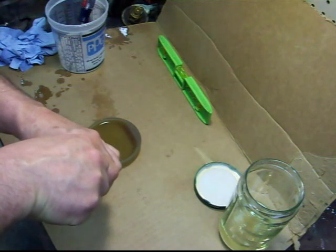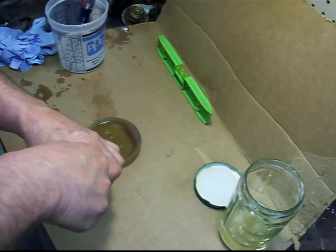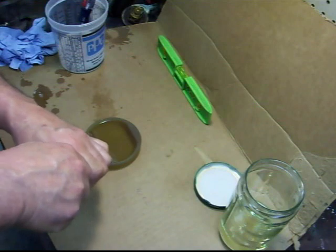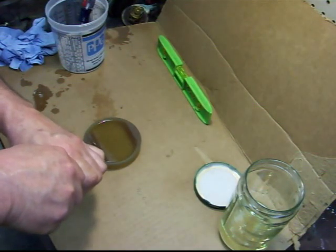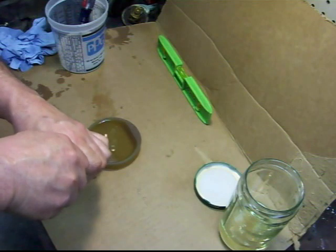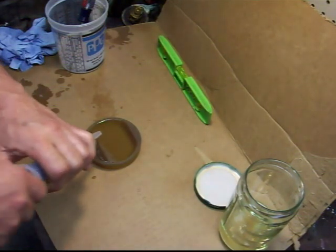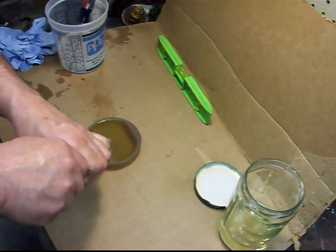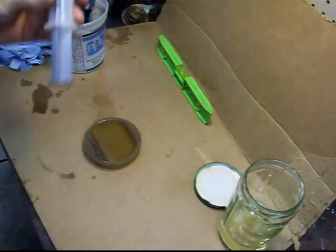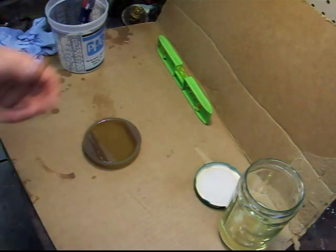I'm not using any type of plexiglass plate — I'm just getting it as level as possible to give us an idea of how much cylinder or dome volume we have here. I want to make sure I get some around these valve reliefs. You can look at this from the side and tell if it's above the level or not. We're right there — and I've got 30. It's half, so it's 30 cc's that this stock piston dome will hold.